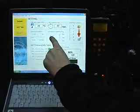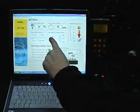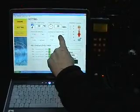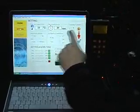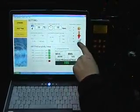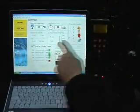We're running on GPL or Metano, LPG or CNG, they don't bother translating that. The system's able to go back to petrol when it runs out of gas. This is always set to yes, and for any modern car, fast. We don't want the car to remain on LPG for longer than it really can run. The temperature correction you can ignore, it's only on CNG, has no use on LPG.